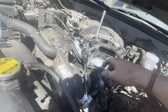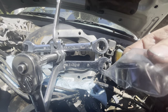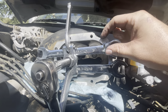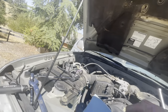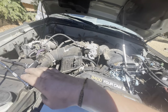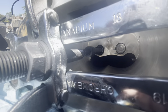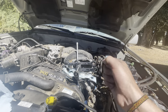Once you get that in there to tighten it on the inside of this bearing, you're going to want to put a 17mm on the outside of the big jaw part. And then I got a little mini extension here and it's a 10mm. So the 10 on the outside, because it's hexed, and then the 17 on the inside, and you'll just crank it down real tight.